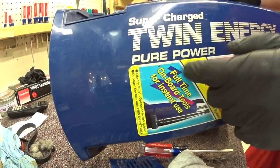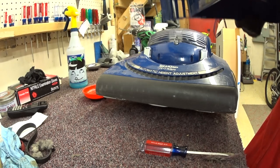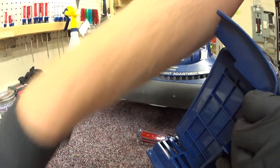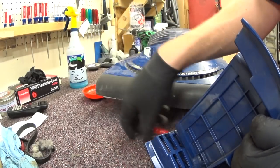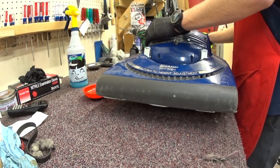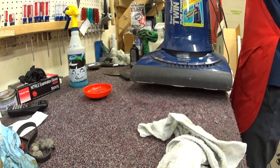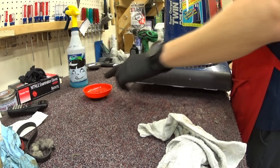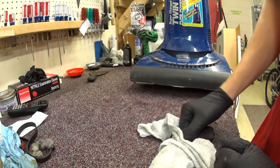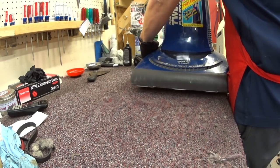I'm probably going to wash this cover before I give it back to the customer — it's just dirty. I'm pulling those filters out; you really can't get them anymore. These are filthy and need to be changed — they've restricted airflow. They never really filtered anything more than motor carbons anyway. That is pretty much all we can do when we get one of these in. If parts were available and this were 15 years ago, we would be changing the filters and the brush roller.